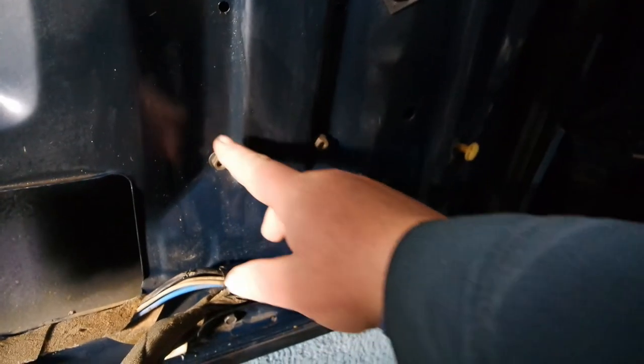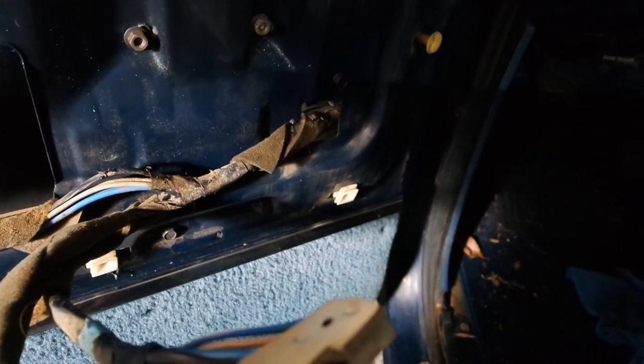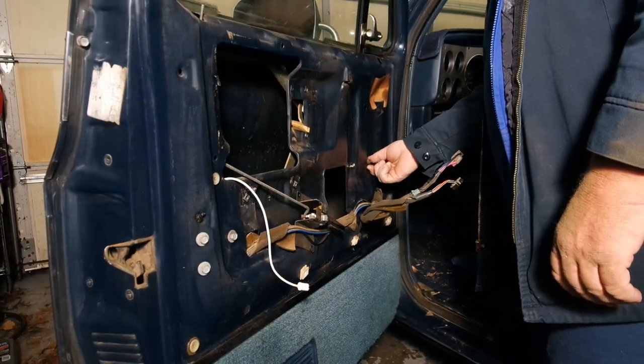This is a little difficult to film. Reaching underneath it, pushing in that tab and pulling straight back — and that's off now. These bolts are loose already. When I bought this truck it came with two power window motors, but it also needs regulators. The previous owner apparently attempted to get this out and couldn't do it, and didn't put it back together all the way before selling it to me. We're going to take off this nut, this nut, and this bolt — this bolt's missing but hopefully yours has it. Mine are loose so I'll just take them right off.